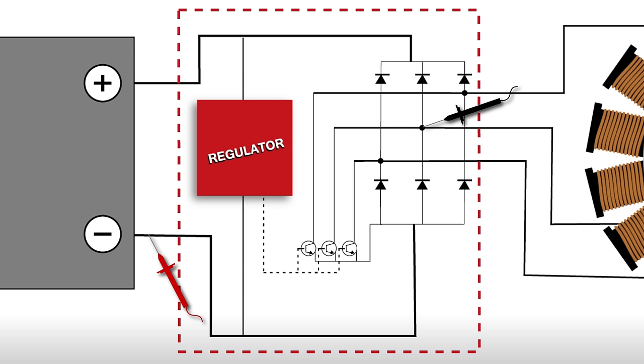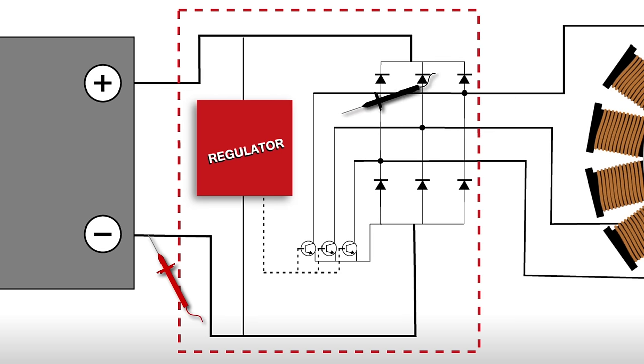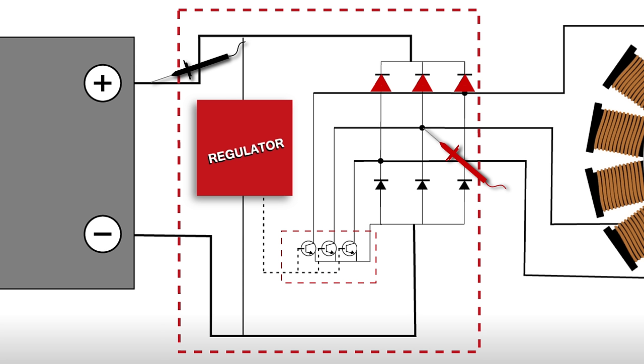So now, positive here, forward biasing back, had no problem. It was going against that gate, so we were only reading those three diodes. When we were going the other direction, we were actually paralleling a forward bias diode here and whatever circuitry they were using inside of the regulator on the other side. So it's easy to go in and read the forward bias across each one of these diodes, but guess what? When you try to forward bias these, you're also trying to forward bias these different transistors down here. So it's going to give you a different reading other than the 0.5.